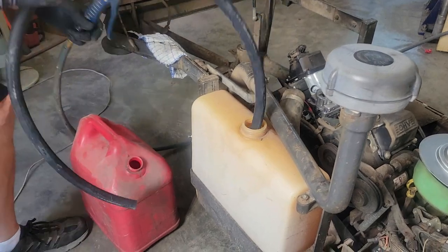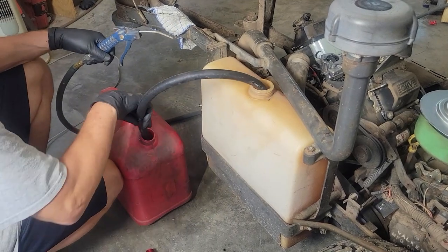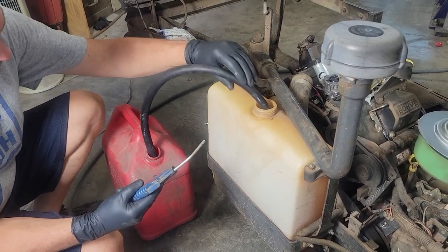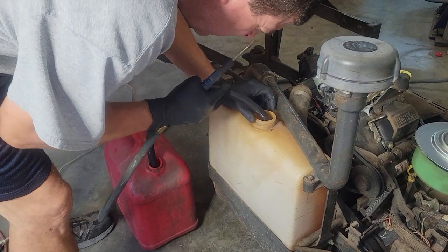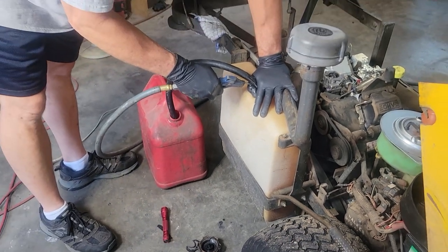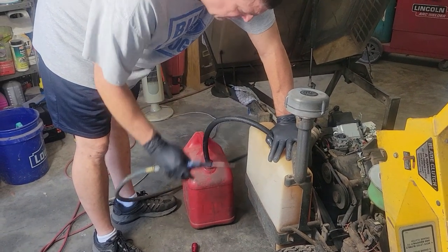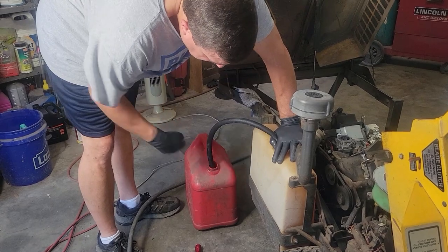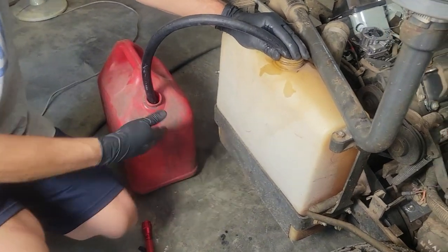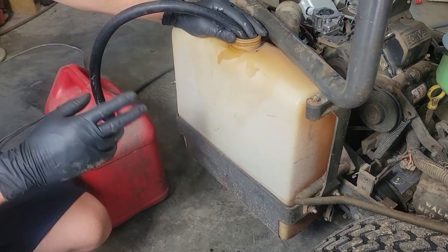All right, guys, what I had was actually a little bit too large a piece of 5/8 hose. I'll show you an easy way of siphoning a tank, if it's like a lawnmower tank or something. Just make sure you're on the bottom where you want to be, and just put some air in. Don't want to put too much. But once we get it going, it'll just sit there and siphon this thing out, because our fuel is lower than the gas tank. It ought to pump it out pretty quick, being that big of a hose. So we'll drain this tank and be right back.